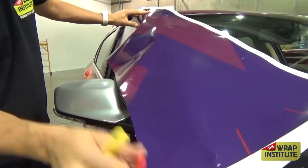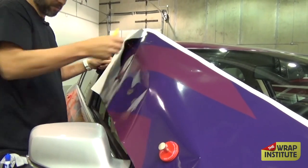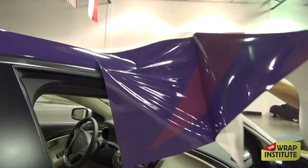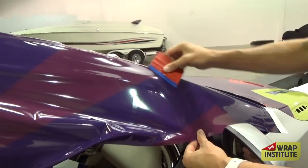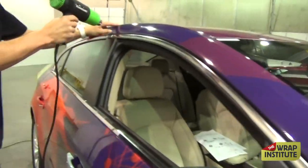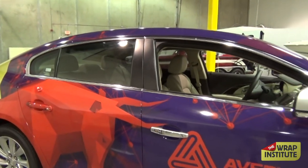The vertical panels aren't tough — nice, simple, and straightforward. No need for production to trim the panels beforehand. Now I'm matching purple to purple on the cutting table — a traditional straight overlap at about three-quarters of an inch. It's just purple meeting purple from the top section of the door to the fender. I pick it up, set the temporary hinge with magnets, create the permanent hinge, take the entire backing paper off, pull with glass, squeegee it on — done. I use the heat gun just to seal the edges and ensure no bubbles or lifting. Almost seamless, great stuff. Thanks for watching. — Justin Pate.